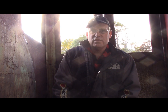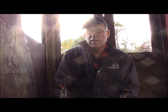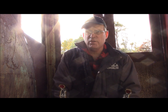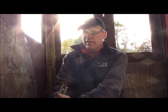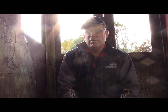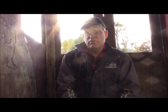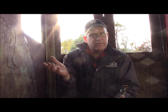Alright, so that's startup. It needs a fuel pump. We determined that, unless the line's got a blockage. You never know, something might have gone up in there and made a nest. That's possible. But for the price of the fuel pump, I think I'm just going to put a new one in and be over it, and we'll start it up again. We're going to have to go to the wreckers maybe next weekend and see if we can find a 90s Cherokee or an '88, '89. Try to get that. There's a piece of linkage missing from the steering box.